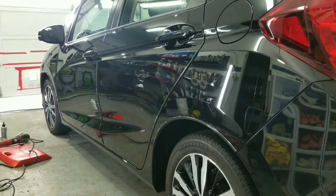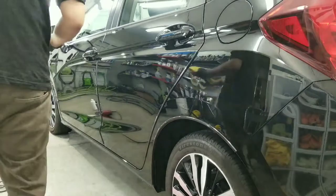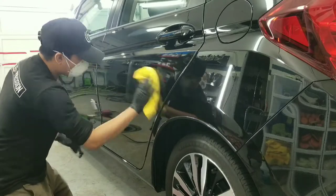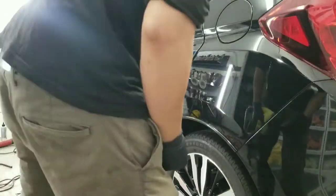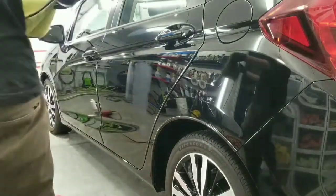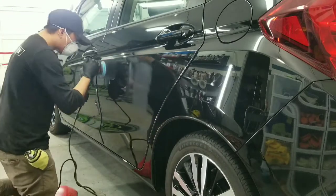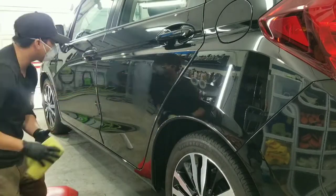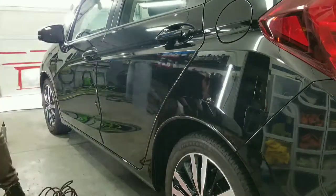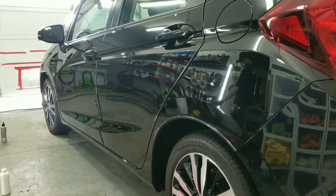After I blew off all the water from the paint, I can finally see what I'm dealing with. I used a solvent to wipe off some of the superficial white scuffs first to reveal the true damage. Then I'm wet sanding with 3000 grit on all the scratches that I see on the door. After blocking it with the 3000 grit and KXK Dynamics, I'm using a Rupes wool pad with M110 compound to compound the scratches out.